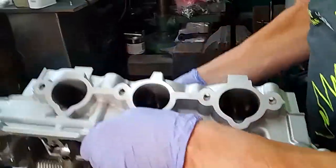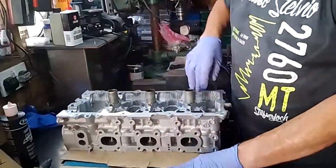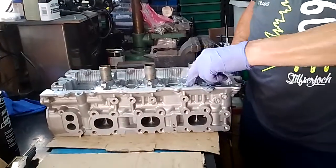Next job, which I'll video in a few days, is I've still got to do all this on the other head. Then I'll have to drop the solid buckets in, fit the cams, spin them around and measure each valve clearance and work out what size buckets I need. I'm putting all the original solid lifters back in the original position, but as I've got new valves that have all been reground and lapped in, the clearances are probably going to be all over the place, so there's a lot of work to do. I hope that's helped - I know it's quite a simple job but it can be as fiddly as hell. It's all about preparation - get everything prepared and things should go fine. If you do have problems and things start going wrong, stop, have a coffee, come back fresh and it's a lot easier. Right, I'm going to stop now and go for a beer because I'm melting. Cheers guys!